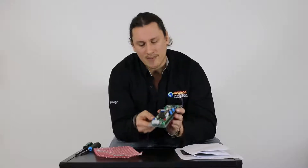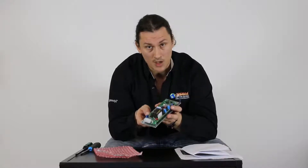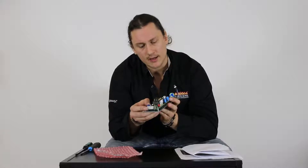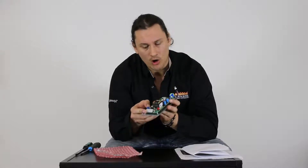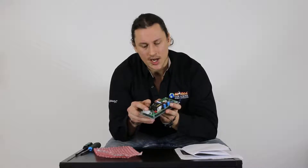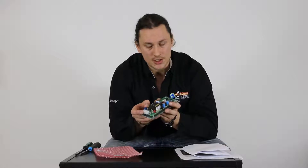Just real quick to go over the back side when installing — we first want to make sure that the stove is unplugged from the wall, that's very important. We have one main Molex plug here at the bottom, so our primary wire harness is going to go right into the main Molex. There is a little locking connector, so once that's pushed in it will lock in place and you know that it's secure.